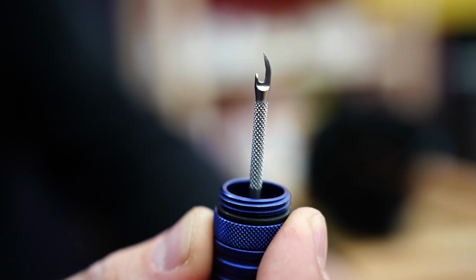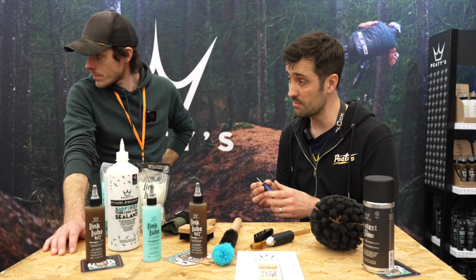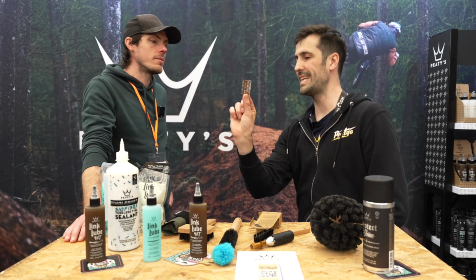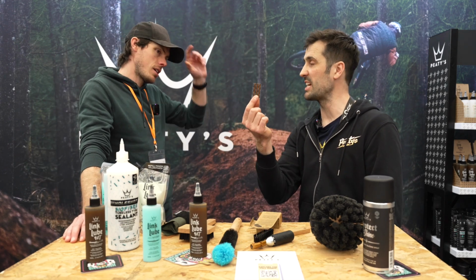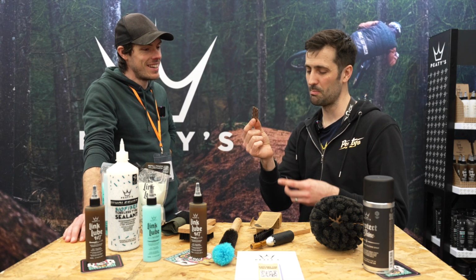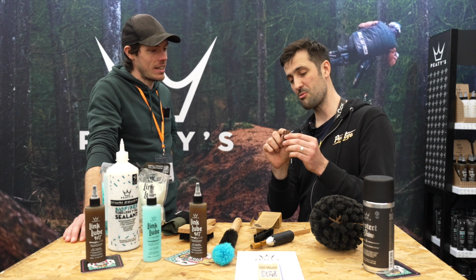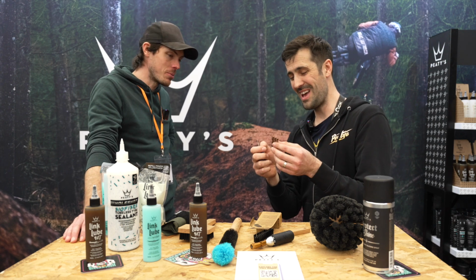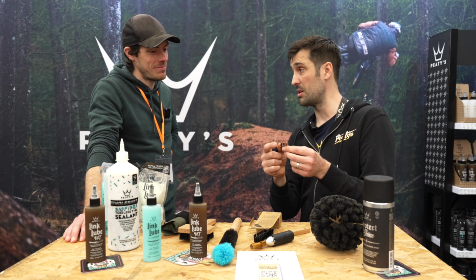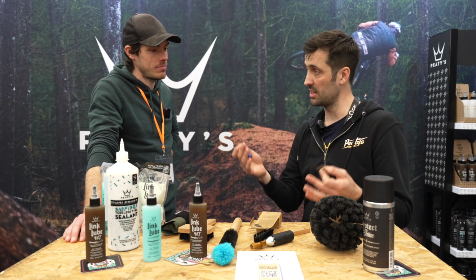So single-sided, that means two things. I don't have a plug sheet here, there should be some there, but they've disappeared. So that's like sticky butyl sticks. Your plugs basically. Are brown as well. Yeah, it's like bacon strips. Or people call them dog turds. Call them what you want. So it's like a fibrous mix. I wish my dog's turds were that small, by the way. And easy to clean up. A fibrous mix of fibres covered in a butyl rubber, and when you put that in, it helps block the hole and the sealant can do its job.